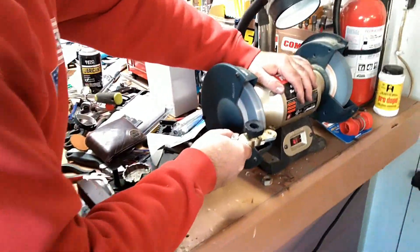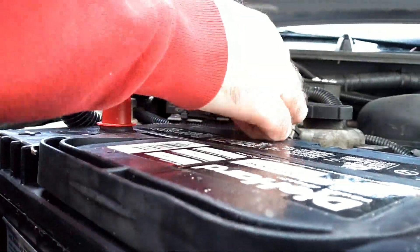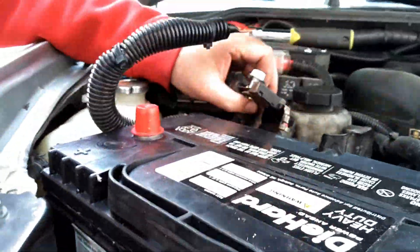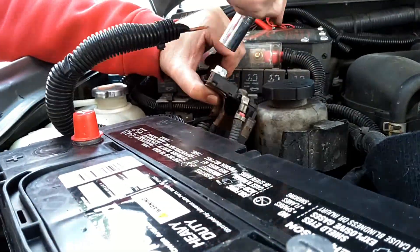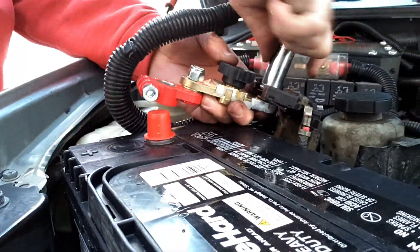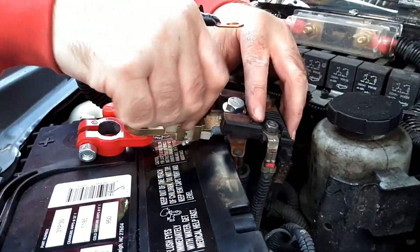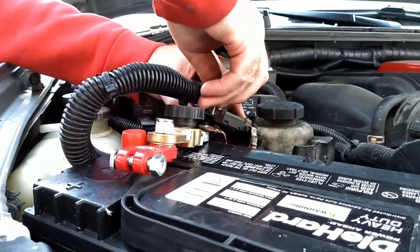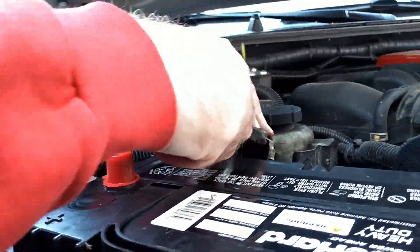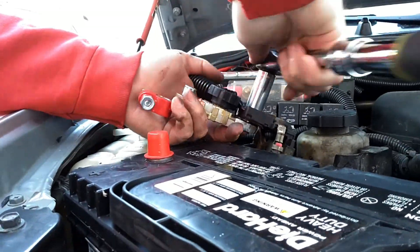Here's getting rid of that ugly old group 24 battery that the truck came with. It was about three to four years, maybe five. I've had the truck for just over three years and the battery came with it, so I wasn't able to find, at least easily, a day code anywhere on it, so I decided it was time to get rid of it. One of the guys on the Club Frontier forum had posted that he, with quite a bit of shoehorning, managed to fit in a group 31 battery, which is nearly half to three-quarters of an inch taller. It's actually quite a bit longer — 13 inches long — and the original is about 10.75-ish, so two inches and a bit longer.